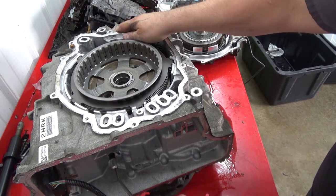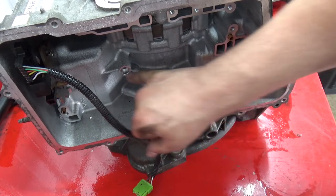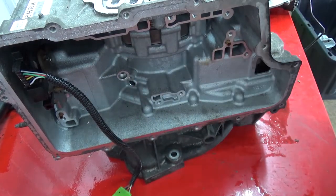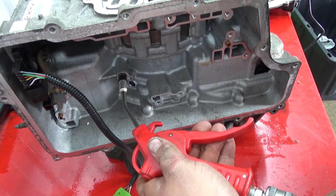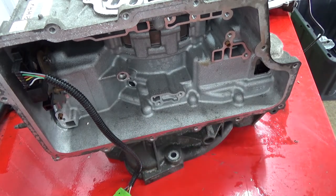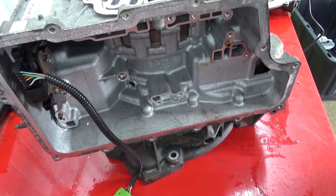Perfect. And you can actually see, let me move the camera. All right, there's the hole that you're putting the air in. And you can look in here and you can actually see the clutch is getting applied and holding. That's the biggest thing, is you want them to hold. Don't know if you can see that, but perfect, perfect. Other than being dirty, I could technically probably put this together, put it in, it'd run fine, but